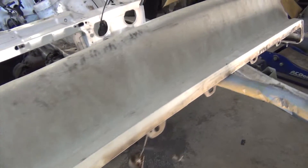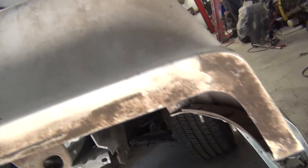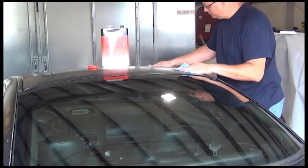When you go to do body work or if you go to media blast, what's going to happen is you're going to have these contaminants get in the air, and when you put that pressure on the paint or on the panel, it can actually embed these molecules into these panels and cause a paint defect down the road. So what we do is we clean everything off, we wash it real good, we wipe everything down with a wax and grease remover so that it gets all of this contaminant off of the vehicle — so that when we go to do the media blasting, sanding, or any kind of body work, we have a nice clean surface to start with.